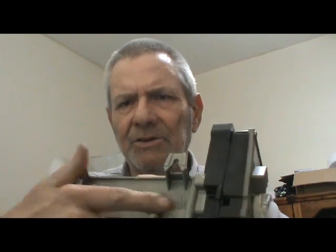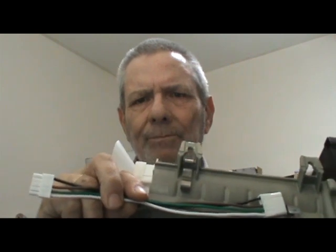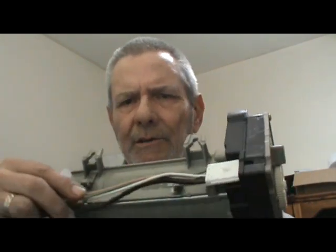What I did was I changed the harness to allow it to work with the modular ice maker. Their new ice maker — my harness was not going to work with it because you can't plug into their new ice maker directly. It has to have that extension cord harness. And that's right here — this is called the jumper harness. It plugs into the connector here, and then it plugs into the back wall. Because that cord sticks out about three inches and there's a plug on it right here that plugs into this one.